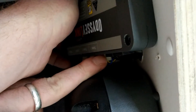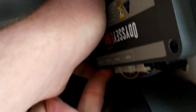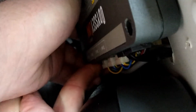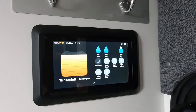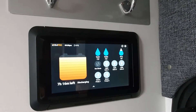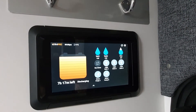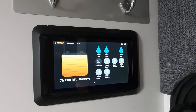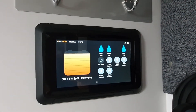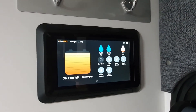Pull out the connectors for the tank and then just put a bit of moisture from your tongue — a little bit of saliva — just across the pins. You'll see my off-sider in the background is doing that. There you go, he's made three out of the four pins wet, and we now have that grey water tank's reading changed. So what we can see is there's nothing wrong with the connector — it's connected up. There's nothing wrong with the wiring. It's purely that the water tank is actually dirty. Now that saliva has dried off and it's reverted back.